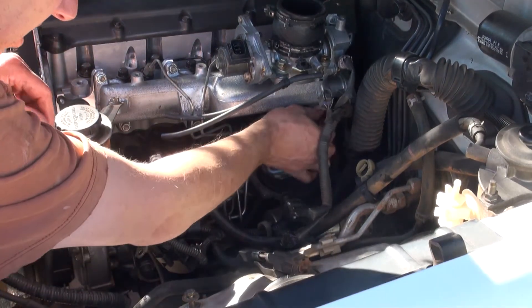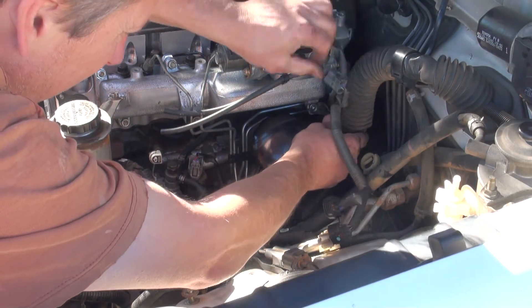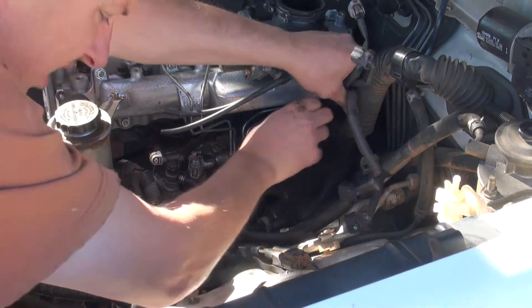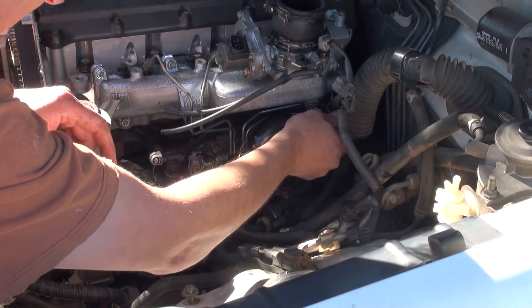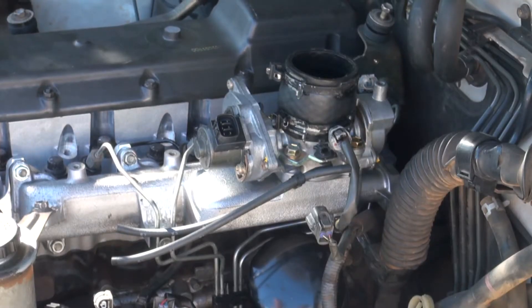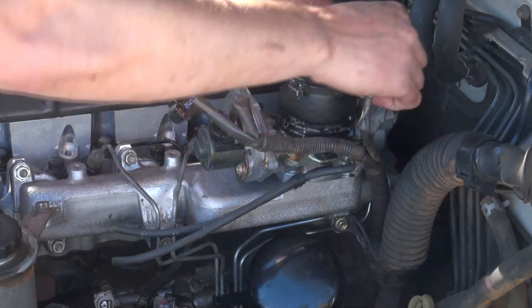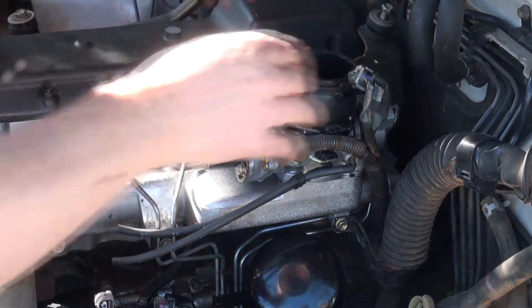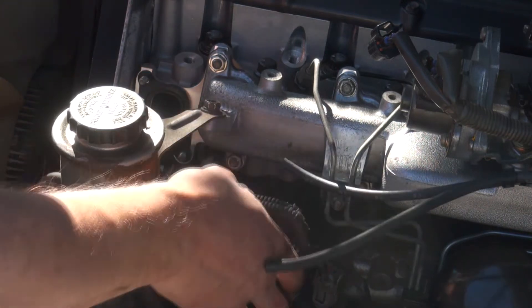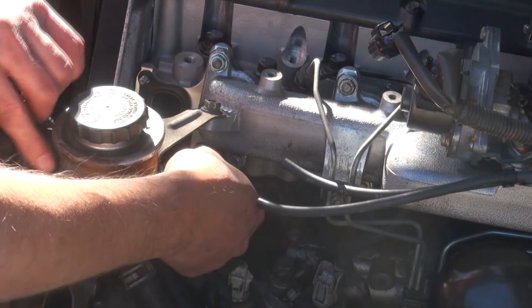Let's start putting some of the wiring back on. Spray the lever cover in grease — oil. Big six-pin connector goes onto here. This one is a two-pin, comes around the back, clips under that. And a thermostat — it's a one-pin thing, clips under that. I'll take it off first. I'm pretty sure these have to come through this side, so first — clip it in.